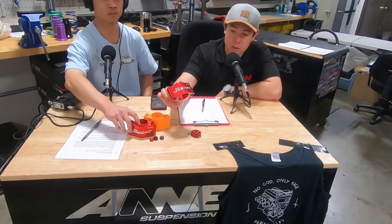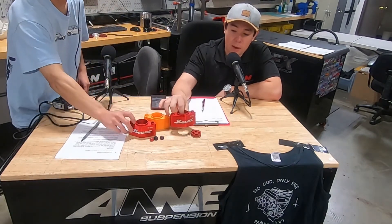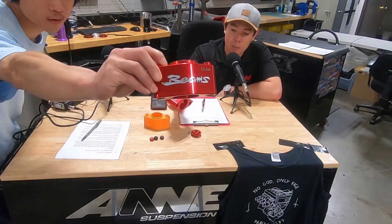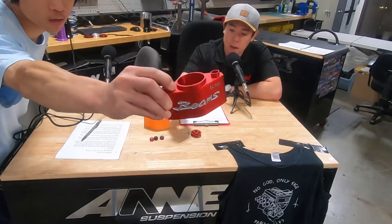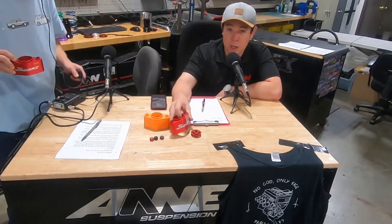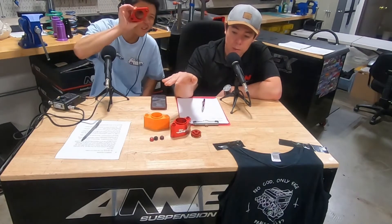These got finished like two days ago. What this is — we've had people with annex suspension and beams. A lot of people are installing beams into these AE86s, and that typically will have the subframe lowered. So you'll change the roll center on the vehicle. Cars with swaps where the cross member is lowered specifically need more help, because you'll start to get the lower control arms angling upwards.